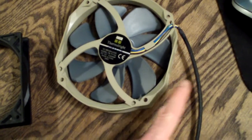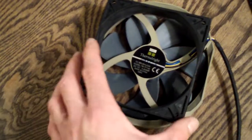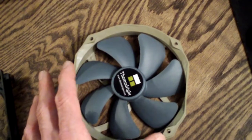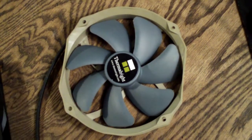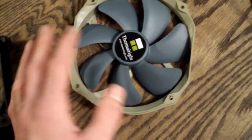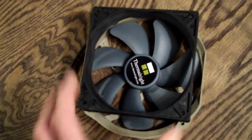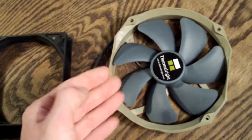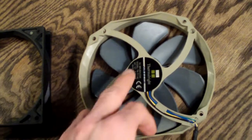You don't want the air to be turbulent. Basically, a fan shroud just goes on either end of a fan. If you put your hand in front of a case fan — and be careful when you do this — you'll feel what almost feels like air coming at you. That's where some people get mistaken, because they feel like it's air, but actually that's air coming over the side and creating turbulence. So if you put a fan shroud there it helps get the air through the fan, and on the other side you put another shroud, and it creates a more direct path for the air to go through the fan. It mainly eliminates the dead spot in the fan.